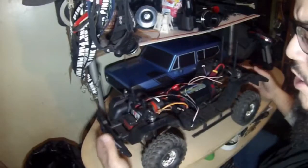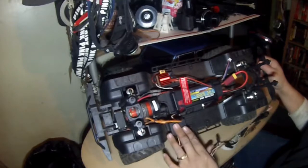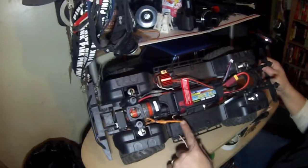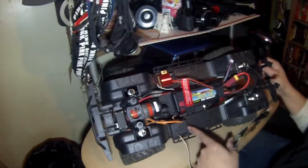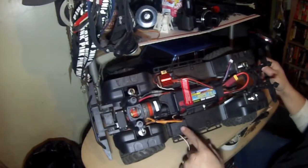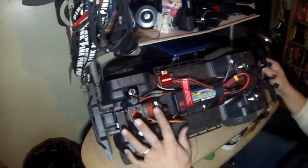Here we are on the inside. This wire dangling here is for my lights — I added it inside the electronics box, which is supposed to be sealed. I don't ever trust those, so I went ahead and opened it up, filled it with dielectric grease, and filled all the plugs on the inside. These connectors actually plug down into the box and connect to the radio. I ran the light wire in, dielectric'd everything, so it's all sealed and waterproof.